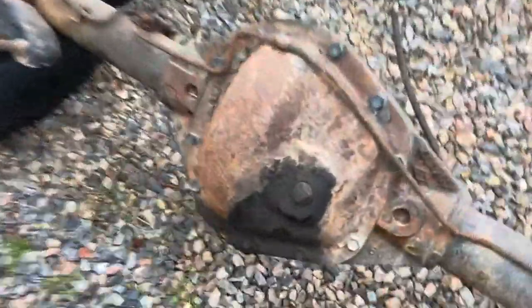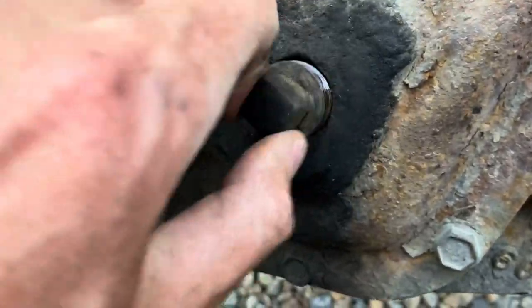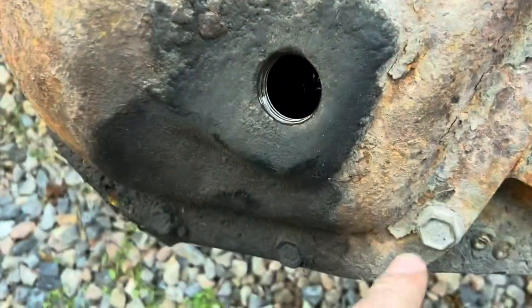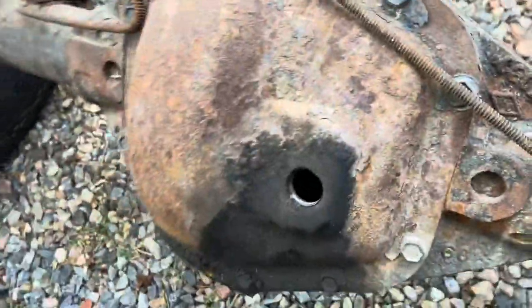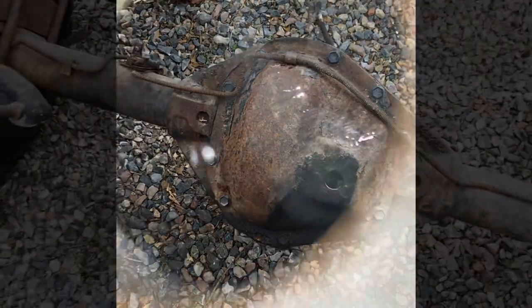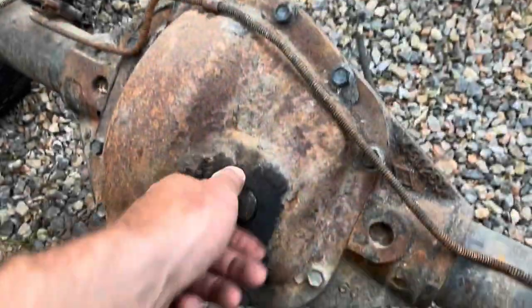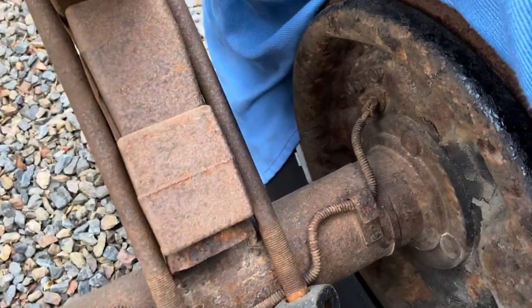Quick evaluation of the rear: I pop the drain plug off and she's dry. Likely either the rear casing seal or the front bearing seal has gone — maybe a combination of both. We'll get this thing filled up for now and see where it starts leaking. You can see the gears inside, but there's not much fluid down there at all — pretty dry.